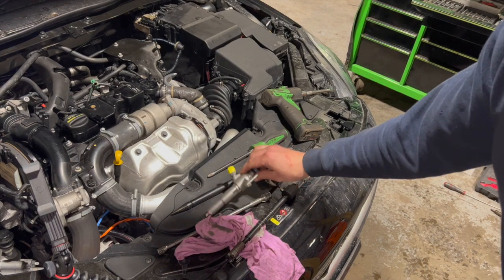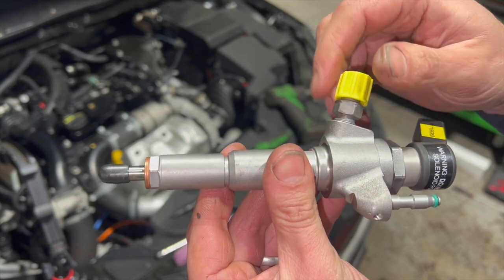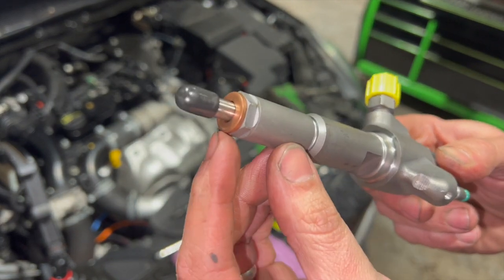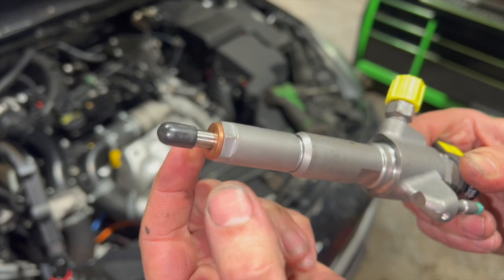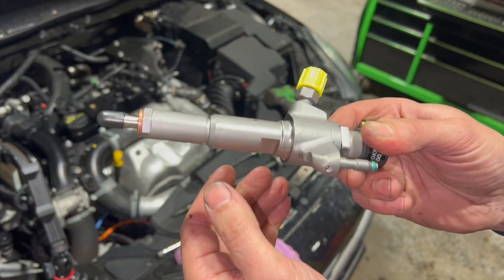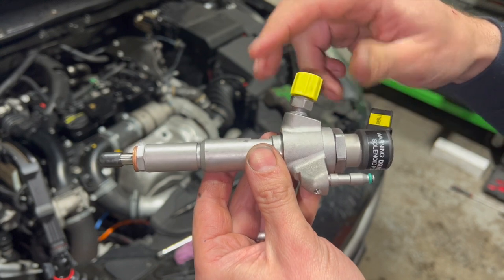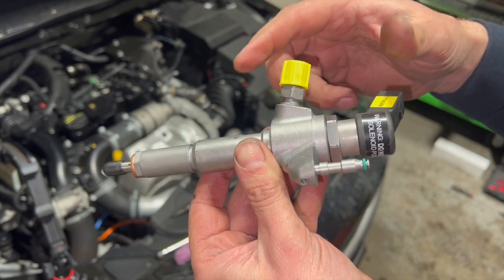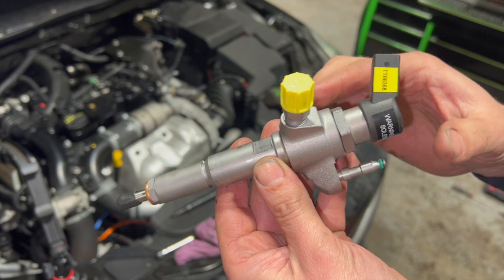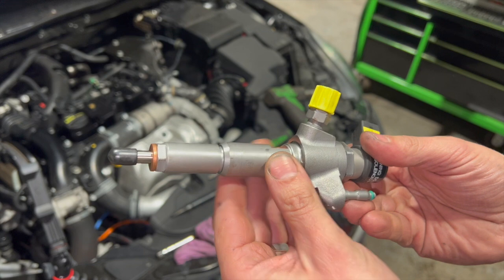At this stage we're ready to fit the new injector. It comes with a couple of protective caps — one over the threads for the high pressure joint and one on the tip of the injector itself — so just take them off. On the new one, the seal is nicely bedded on there. If the seal was a little loose, I'd sometimes drop the seal in first to make sure it lands nice and flat, then drop the injector in through the seal. Once it's in, I'll wind the threads for the high pressure hose on by hand without fully nipping it, feed the clamp through, put the bolt in, torque it up, and then give the high pressure hose a final nip.